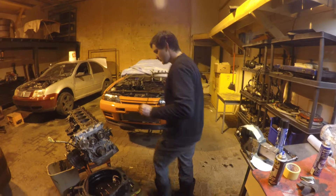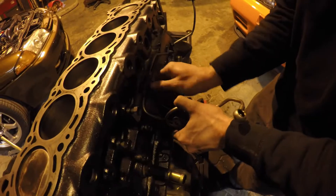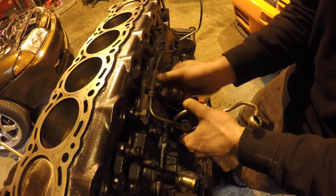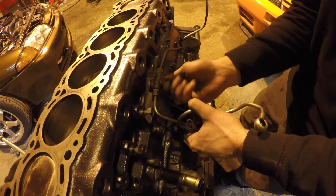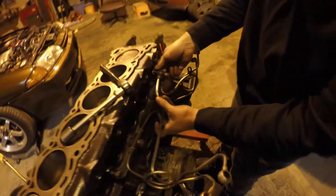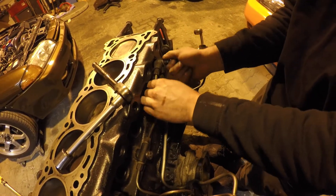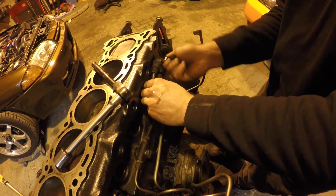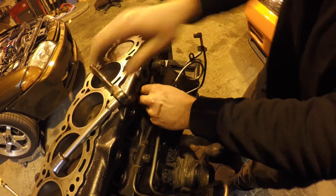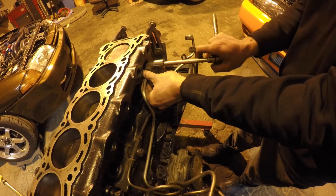I changed the little copper o-ring on the turbo oil lines. I won't be tightening them all the way until we put the turbos on, just in case we have to clock the lines a little bit. I'll put them snug so they don't move around, and screw them back into the block — but not fully tight until the heads and turbos are on.